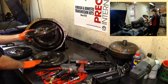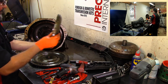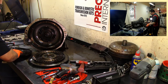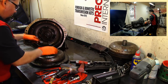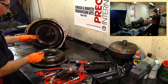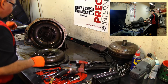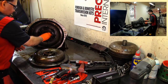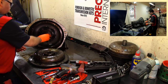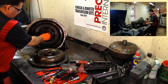our front cover first. And this is held together by a snap ring here and a snap ring here, to keep it from moving, right? So this would be considered like one fan and then another fan in front of it. And remember, you have those three snap rings separating it from one another. Thrust washer and the race. Now we have a sun gear, and we have another thrust washer, and its race.